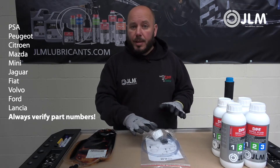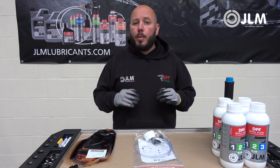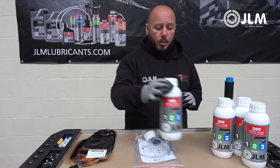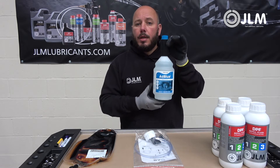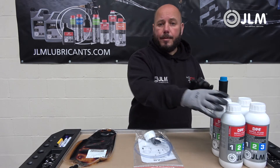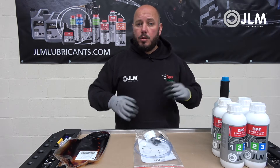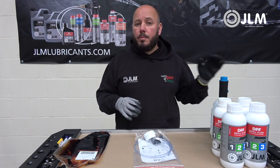Before we start, I'd like to give you some advice on do's and don'ts. Something we unfortunately see is people occasionally mixing up the DPF refill fluid, which is designed to fill up the Eolys tank, with AdBlue. AdBlue is a completely different, totally separate system — it gets injected directly into your exhaust, whereas the DPF fluid via the bag gets injected into your fuel tank. You do not want AdBlue making its way into the fuel tank. Do not mix up the two fluids — AdBlue in your fuel system would be catastrophic.